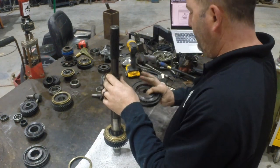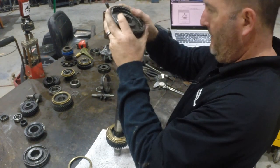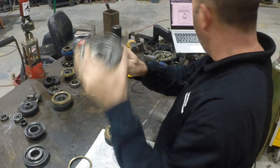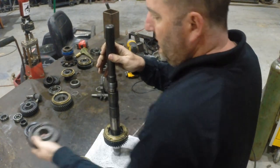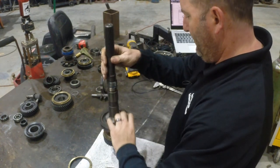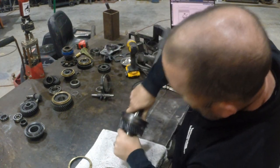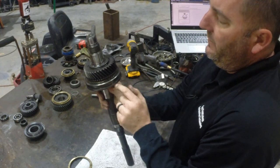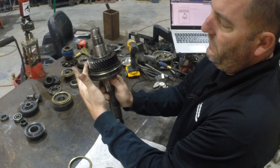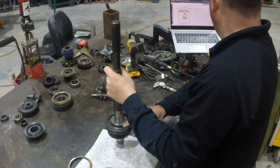Let's go to the two-three sleeve, which has a thrust surface on the backside — that's first gear side. So this guy with thrust surface facing up goes on. I'm not in love with this process right now. Some pictures upon disassembly would have made this a little bit easier. When I get it on, I want to make sure that my keys are lined up with the piece of brass and that the brass only wiggles inside the slots where the keys are.